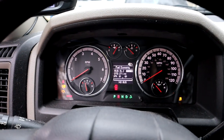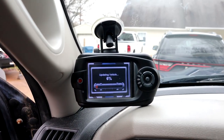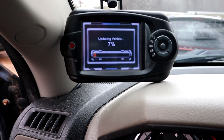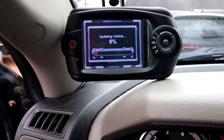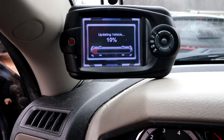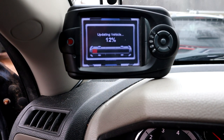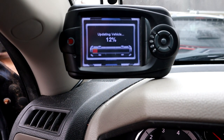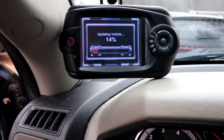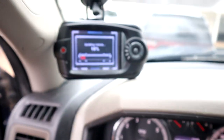What it's doing now is actually updating the vehicle, pulling the stock tune file and saving it to the Diablo Trinity. You're going to hear the vehicle make some noises, some beeping, and some lights are going to flash while this process happens — this is normal. This will take a little while, sometimes up to five to ten minutes. Make sure you have a good, healthy, charged battery. I recommend taking the vehicle on a 15 to 20 minute drive first and then doing this immediately while your battery is charged up, or hook a battery charger to the car.